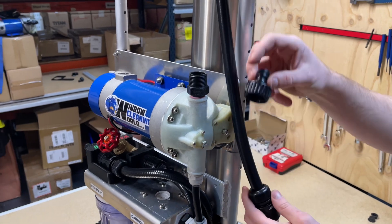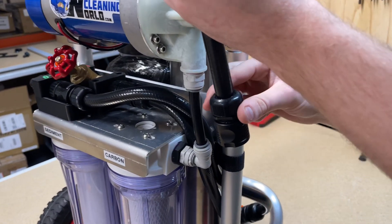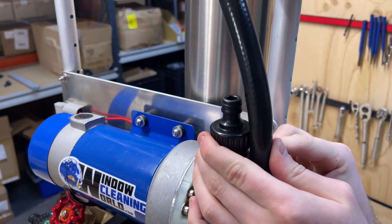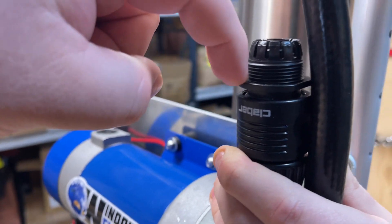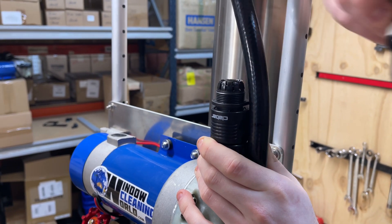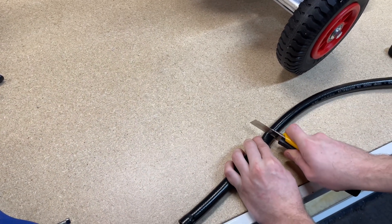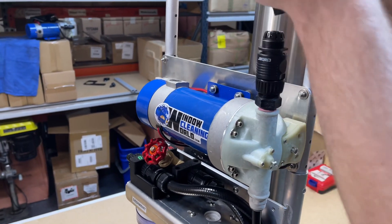The last step is to add the tap adapter back onto the pump. We need to trim the black hose, so take the bottom fitting off and remove it from the hose. Put the quick connect tap adapter back onto the tap adapter. Now line up the hose with this edge here — that's basically where you need to cut it. Maybe cut it a little bit lower to give yourself some wiggle room. Mark it, then use a nice sharp blade to give it a clean cut. You can take the hose off to do this — use a nice long blade with a back and forth motion and you'll get through it pretty quickly. Don't forget to put on the collar.